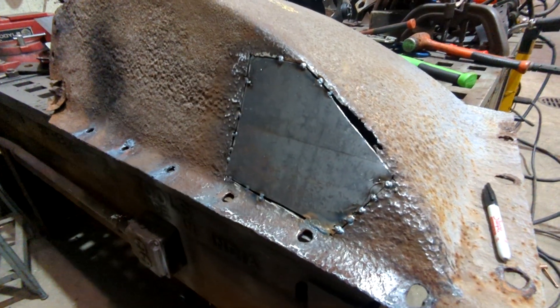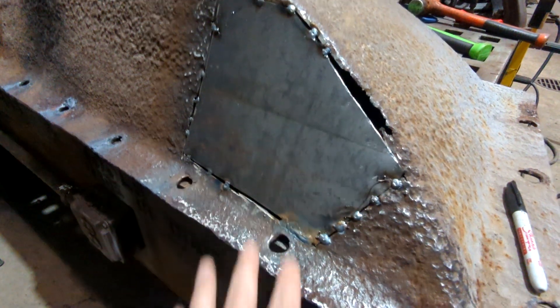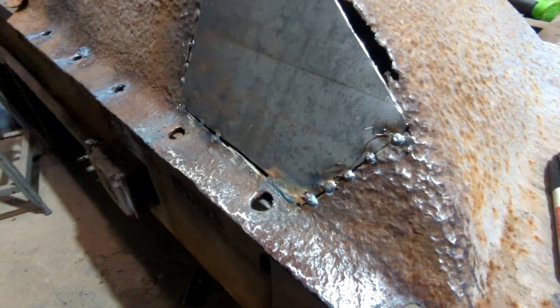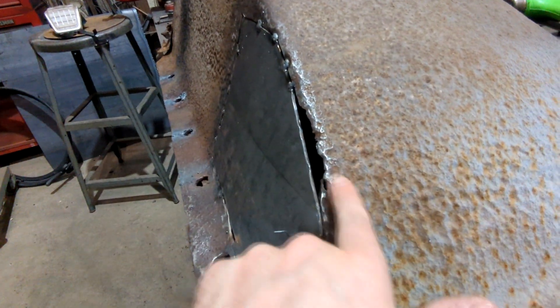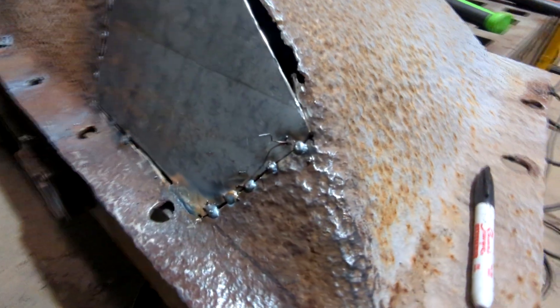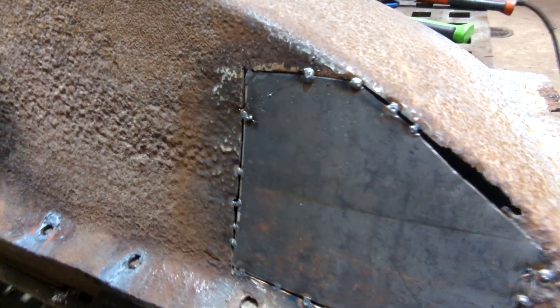One of the things I really enjoy about doing metal work is just how malleable and formable thinner metal is. You can see I didn't even break out the torch, and for the most part we were able to fit this in pretty nicely. I'm going to deal with this part next — we're going to replace this section here. You can see without even using any heat, just using the heat the welder made and a few tacks, we were able to get this piece to fit pretty nicely.